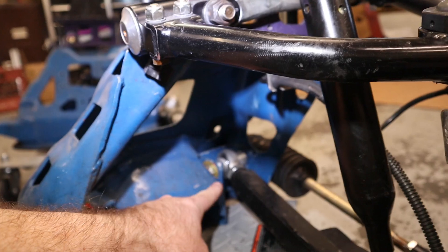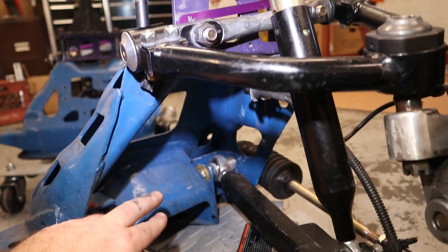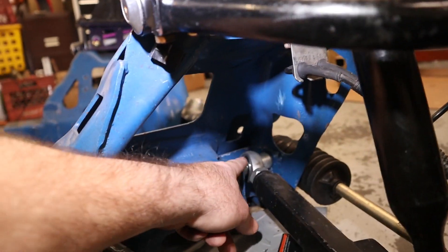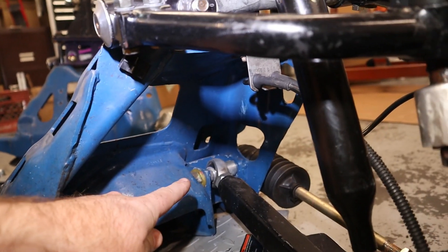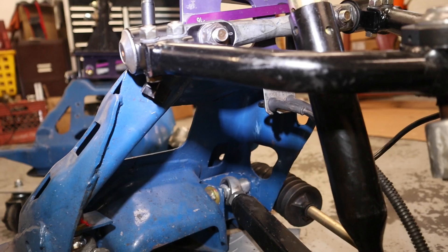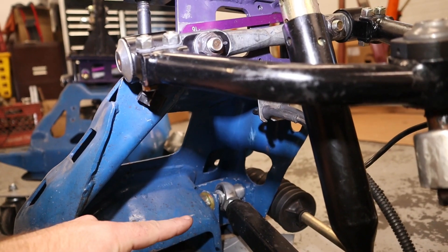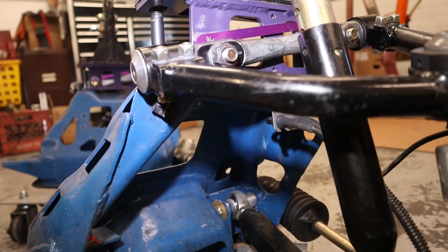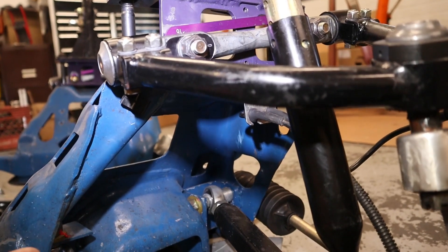For the mounting of my control arms, I built a little bracket in there with three holes and welded that in, instead of trying to modify the center section or cutting holes directly. It's all bolted to this bracket that is welded into the K-member and has three different holes: the lower hole which is the stock location, then one inch up, and then the top hole which is two inches higher than stock. Those two raised holes are basically what a lot of aftermarket K-members are doing, and they improve your roll center and camber curve. Right now I am in the top hole.